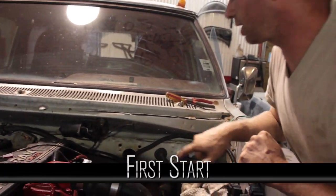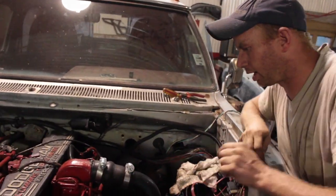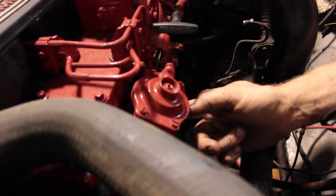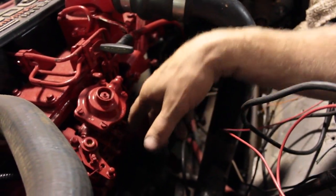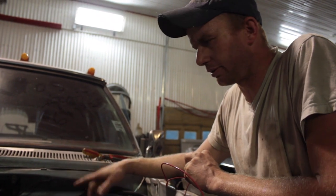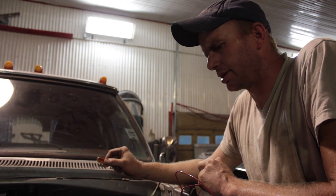We're not gonna run it very long because the transfer case still has to come in and there's a bearing on the counter shaft that can pop out, so I'll put a washer on there for now. I'm gonna hot-wire it by hand on that one bolt on the VE so if I want to shut it off I can do it right away. The starter doesn't work yet because our clutch neutral safety switch is broken, and the master and slave cylinders are on order.